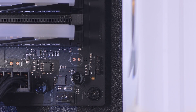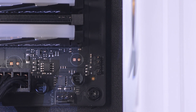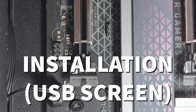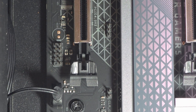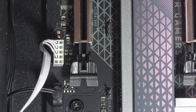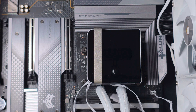The three-pin connection is the ARGB connector. Take the end and connect it to the ARGB header on the motherboard — plug both ends in and that's done. Then the USB 2 header on the bottom of the board — take the USB connector that comes with the screen and plug it into that header. Once that's done, the screen will have power. And that's it for the installation.